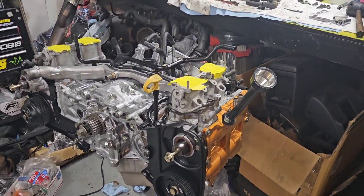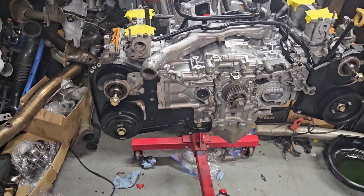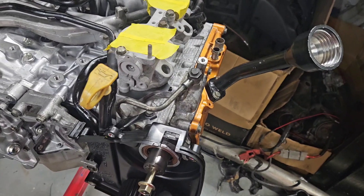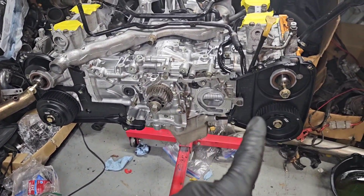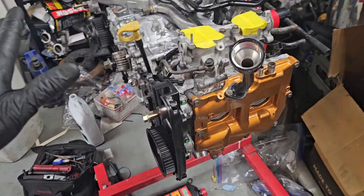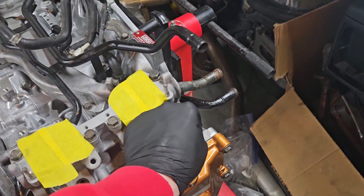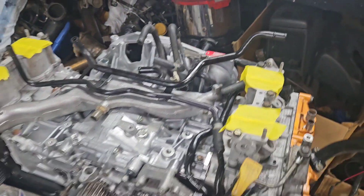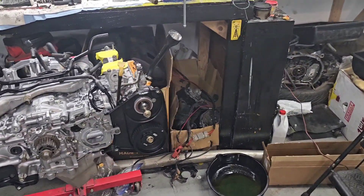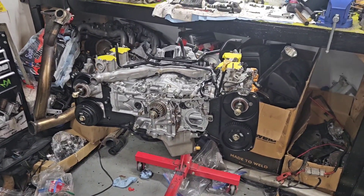This is where I'm going to leave it for now. I need to order a timing belt kit and some intake AVCS gears, but those gears alone are like $400, so it's very expensive. We'll come back to this when I get more parts. These are looking pretty fancy — just kind of set them on there. I want to get a water pump, timing belt kit, and all that, torque everything to spec, put our new covers on, then start dealing with the intake and wiring. I threw the cam sensors in — couldn't find any O-rings to replace those but they seem alright. It's looking pretty good — starting to look like an EJ257. Pretty stoked! Thanks for watching — give us a like and subscribe, post any questions in the comments. We'll see you next time.